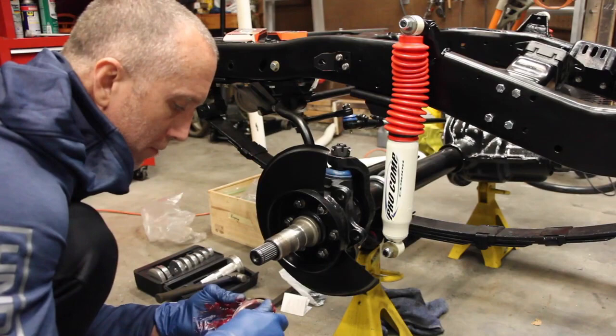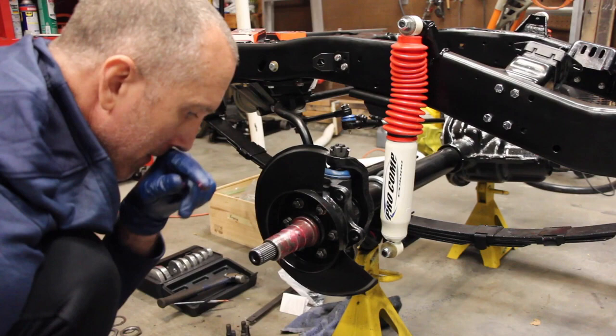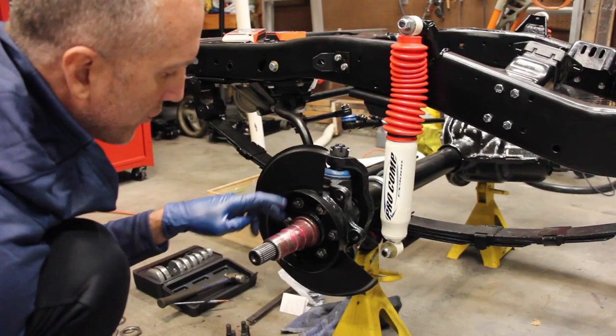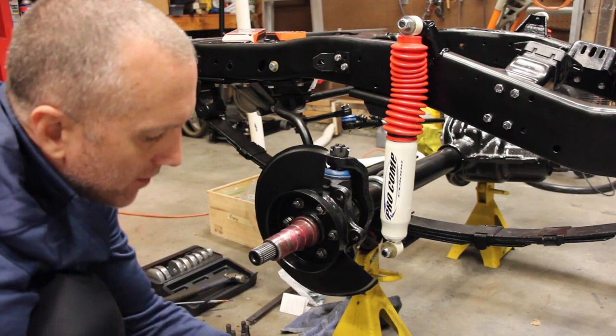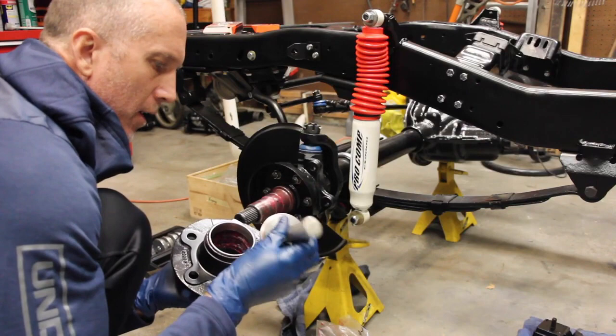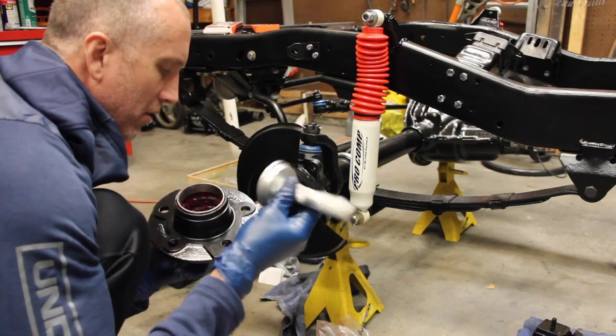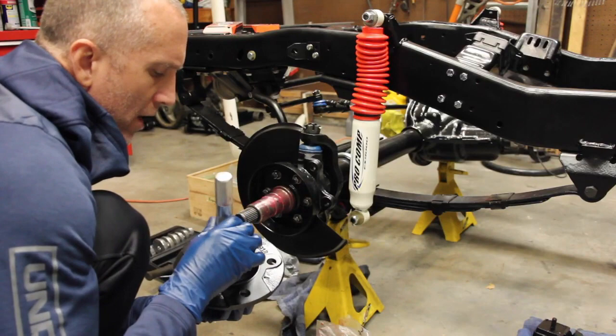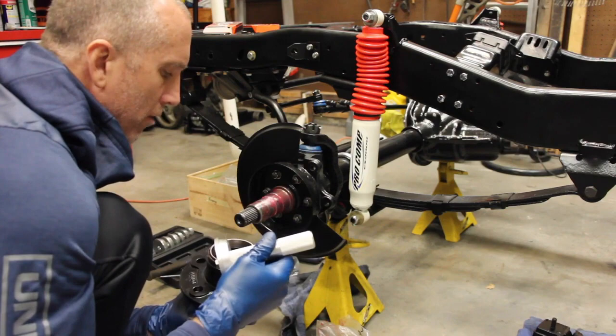While greasing the bearings, I also applied a liberal amount of bearing grease to the inside of the actual wheel hub and lubed up the wheel spindle itself. Take your inner race — you're going to need a race and bearing press. I got the aluminum one; the plastic ones are worthless, so get a metal one. I got this one on eBay for about 25 bucks. I'm using a 72-millimeter press — it fits right on top of the bearing and right on the inside of the lip of the wheel hub.